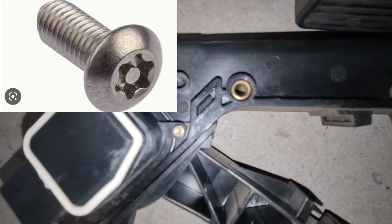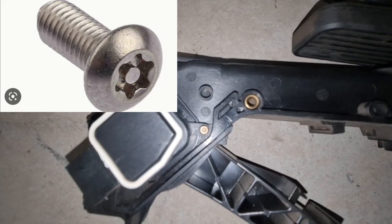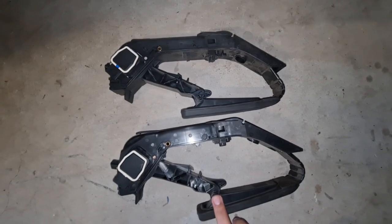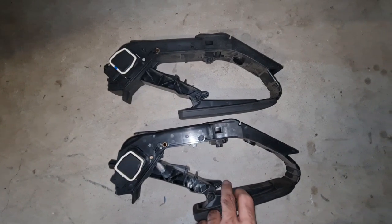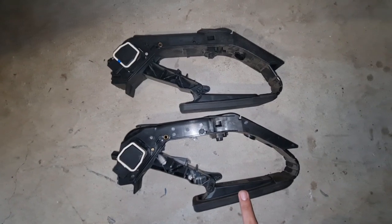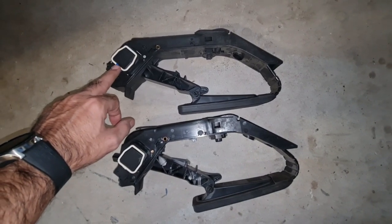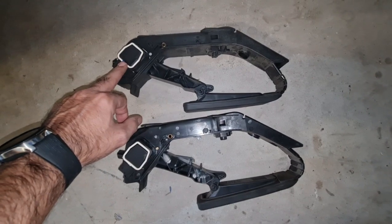There is a pin inside the security screw head, so it's actually better to replace the whole gas pedal. I think it is even possible to use the CLK55 or C55 sport gas pedal if you want. But let's go ahead and put my CLK320 gas pedal inside the CLK500 and see if that works.